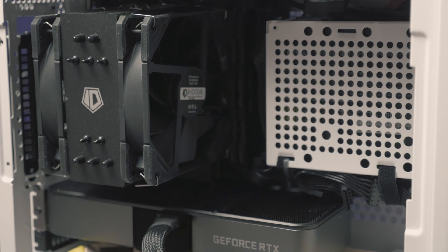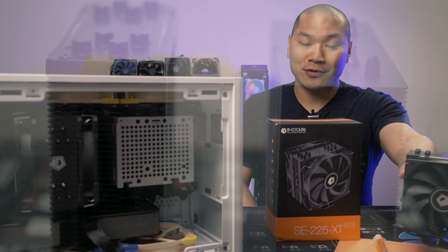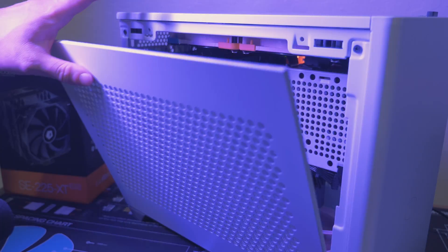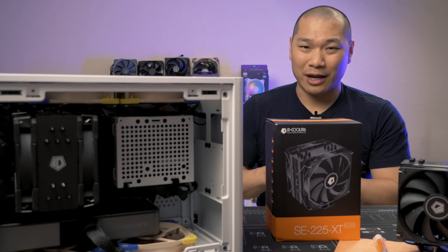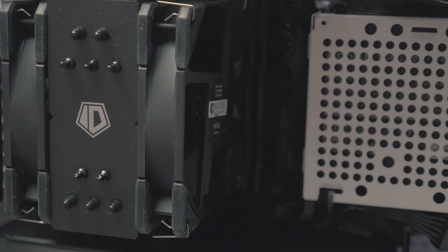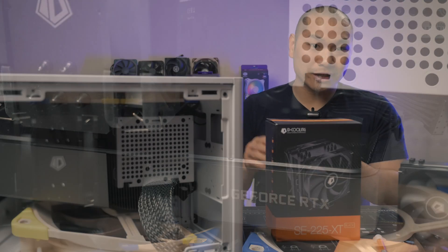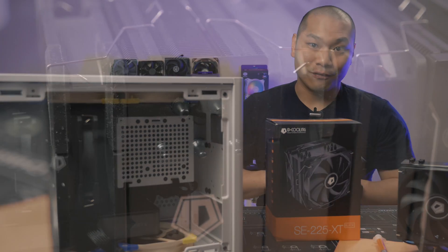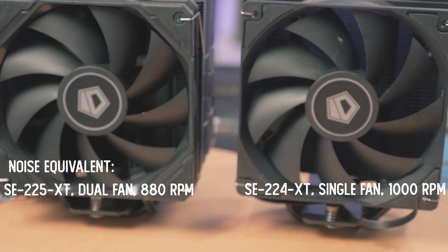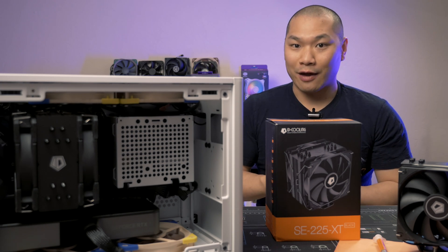Without further ado, let's get into thermal testing. For thermal benchmarking, the main comparison was between the SE224XT and the new cooler. I tested these in the vented Cooler Master NR200 Ryzen 3700X test system, which was set up as a rear intake. It wouldn't really matter too much since the graphics card was idling with no fans on, but I set this up based on how I would normally orient the fans with this Ampere Founders Edition card, which would be a rear intake for the tower cooler. Since we are testing with similar fan configurations, I adjusted the RPM on the dual fan configuration so it would produce noise equal to that from the single fan configuration. With a closed case at 20 centimeters away, I targeted a noise level of two and a half decibels above the noise floor.